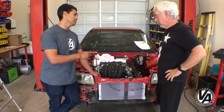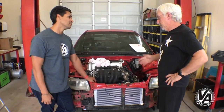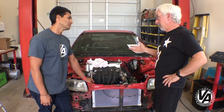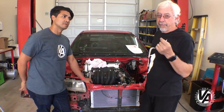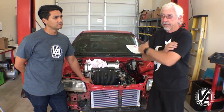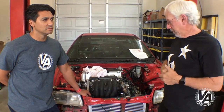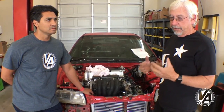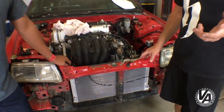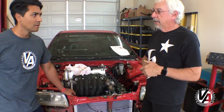That anodized aluminum was a little bit beyond our budget, so we just bent some steel and it works really well. This radiator has been used in other projects because it's cost-effective — typically less than $200 with shipping, sometimes less. We got this one for about $78. It's a first-gen Rabbit radiator — Mark 1 Rabbit — and it has two side outlets and no radiator cap, so you can flip it right or left to use it on B-series or K-series.